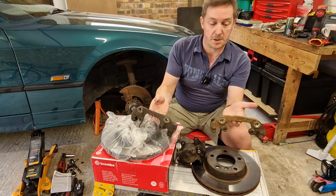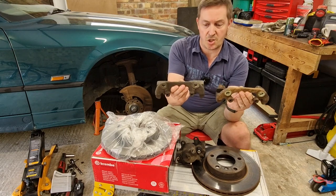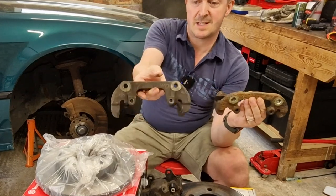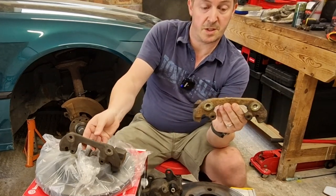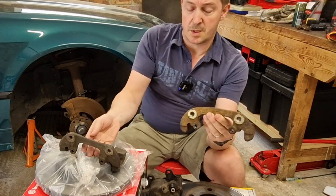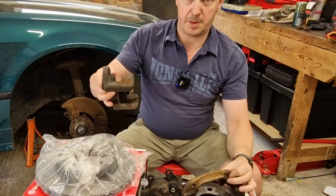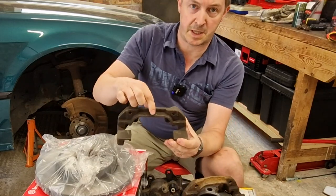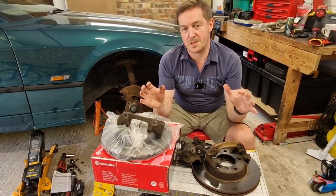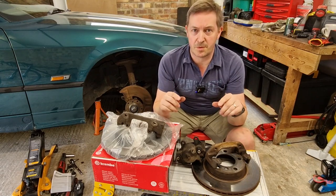It's notably different to the regular one. This has come off my car — you can tell it's 30 years old so it looks terrible. The key identifying feature if you're looking for one of these caliper carriers second-hand is that the top of it is completely flat, whereas on the 286mm caliper carrier it's ever so slightly domed. Also on the back there is a piece of metal on the carrier for the bigger disc that isn't present on the smaller one.